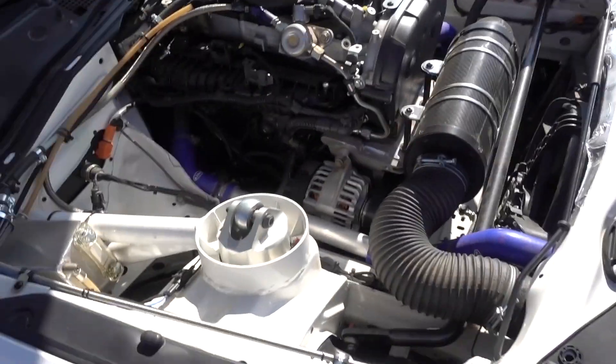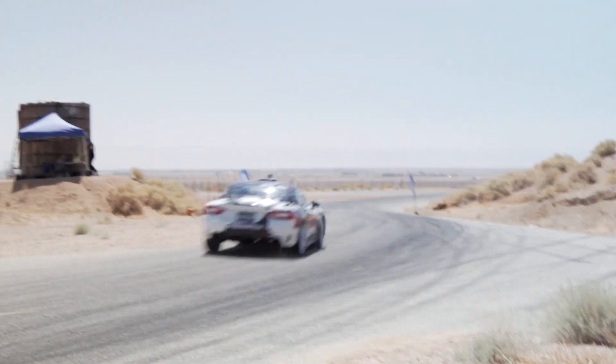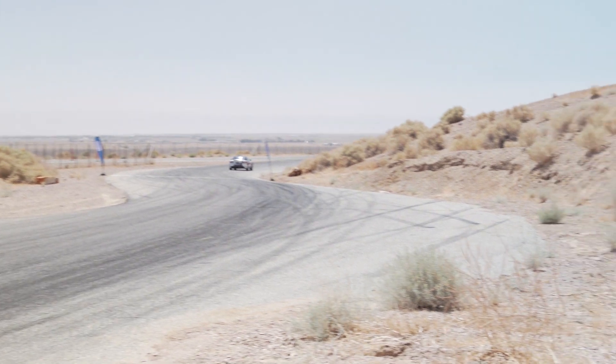While the engine may look pretty sedate, this is a direct injection engine with turbocharger, and stacked in behind it you've got a paddle shift six-speed sequential Sadev transmission. Launch control, four points of ALS, and maps for high boost to low boost. And then you've got traction control for wet, snow, dry, medium grip, low grip, and high grip.